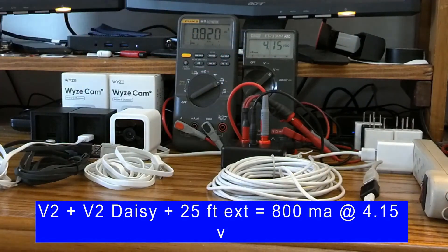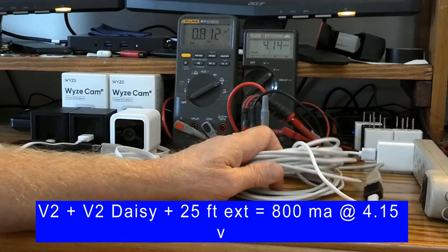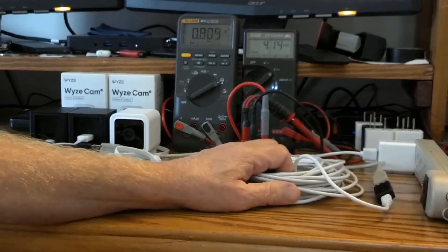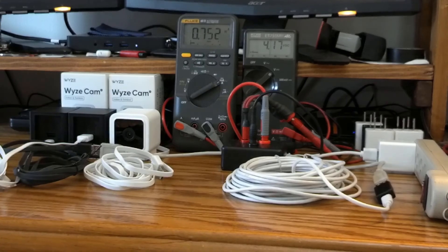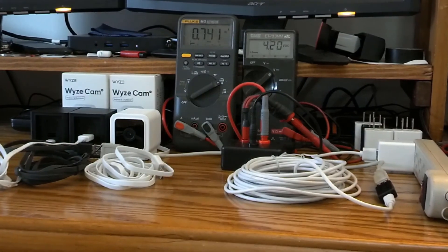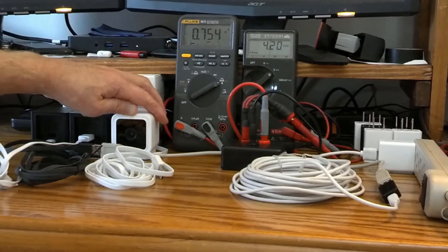If you're having camera issues while using extension cords, I would highly suggest you do not daisy-chain, and try to use extension cords that are 10 feet or shorter. Because I had issues with the V2s, I was not going to connect a V3 under these low-voltage conditions. I've reduced my cable lengths to no more than 10-foot extensions outside, and I'm now ranging right around 5 volts on all my cameras — so I feel safe installing my new V3 out there.